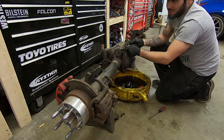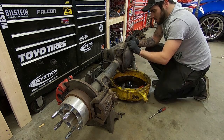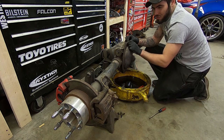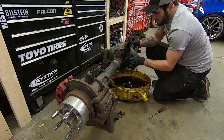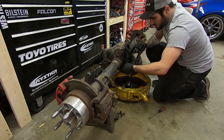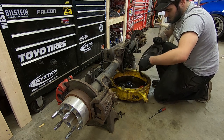I literally do not care for gear oil at all. Now this rear end actually has a paper gasket, but I'm not going to use it. I'm going to use RTV and just make my own gasket for it. This one actually has a gasket — that's nice. I must have put one back on it or something.